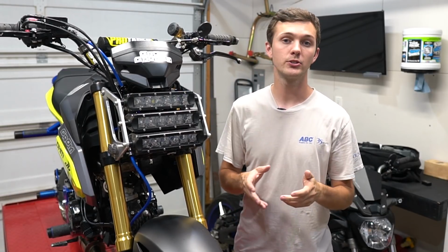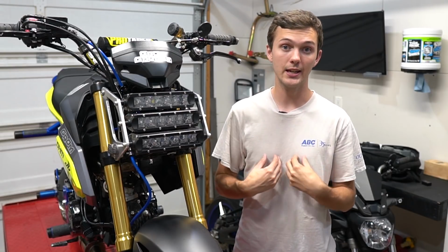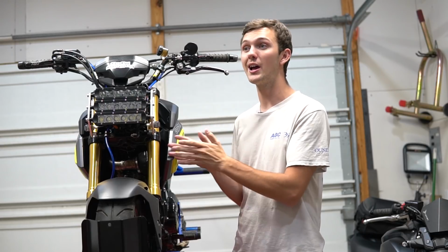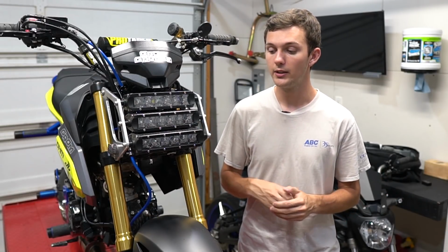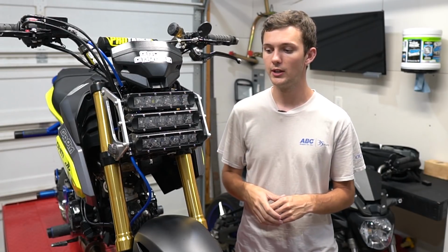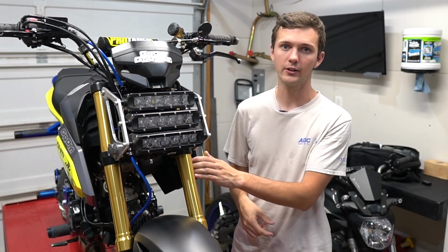As for the turn signals, they are literally just plug and play. At least for the TST ones, you didn't have to wire them in, and you should be able to keep your stock connectors, so you shouldn't have any problem there. The turn signals should just work just like normal, no issues there. Now, you might have to drill a hole through the bracket if you do want the turn signal. Again, try to make sure they're not too thick because they will hit the fairings.